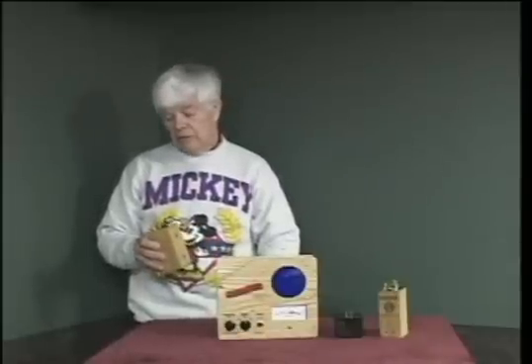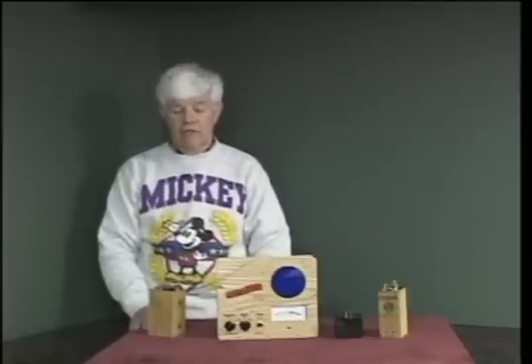The three testers that come to mind — the most successful coil tester is probably the hand-cranked coil tester. Ford thought enough of this particular tester to actually have them produced, and almost every Ford dealership did have a hand-cranked coil tester during the Model T Ford era.